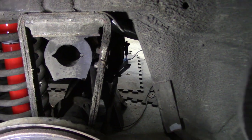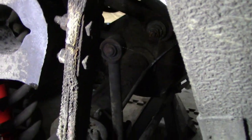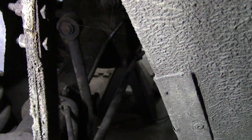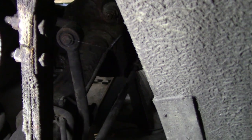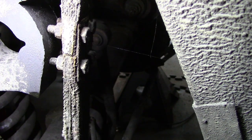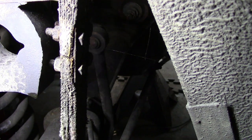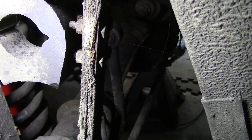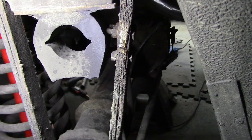Quick look at the driver's side — the bolts here are the opposite of how I've done them on the passenger side. The reason I decided to put the nuts on the outside is you can see how close they are to actually hitting the bump stop at full axle travel. By putting the longer part of the bolt on the outside, it won't come in contact with the bump stop. That's why I decided to do the other side in the opposite direction.